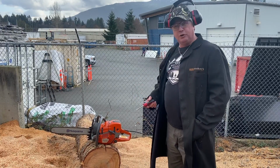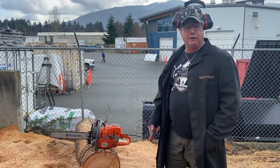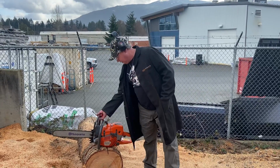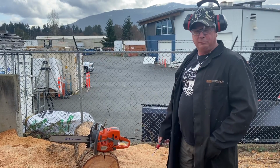But when you get out in the bush and the air filter is plugged, it'll actually calibrate and then lean out for the air filter being plugged. Or if it has an air leak, it'll run richer to make it still run that way, which is good in a way, but really it's going to blow up probably, and you're going to have more problems later.